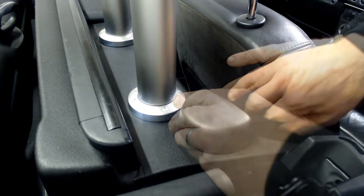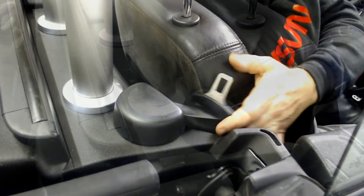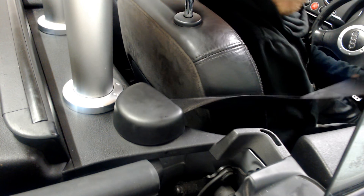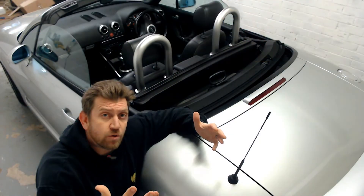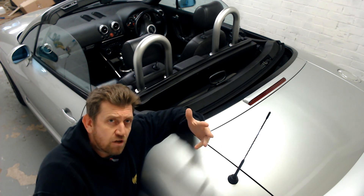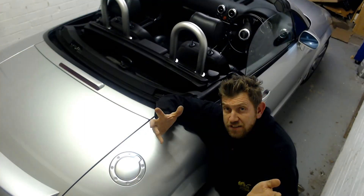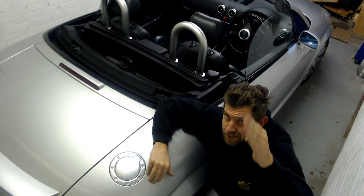Now click the cap into position once more, and if all is lined up, the bracket is firm enough to spring back into the lips of the cap to lock it in place. This is a solid enough solution to stop it coming off when I pull my seat belt, and also not as final as gluing the actual cap to the car - that is a bad idea in my opinion, as you would probably have to break the cap completely if you need to remove the seat belt in the future. Job done! If you like what you've seen today, please think about giving a thumbs up, subscribing, and don't forget to check out some of my other Audi TT content on the channel. Thanks again for watching - see you soon, take care.